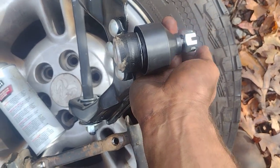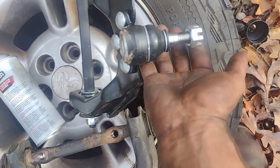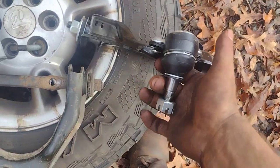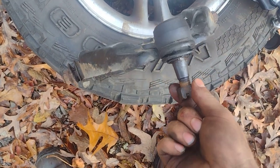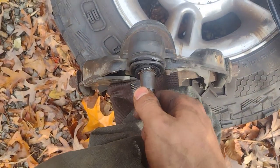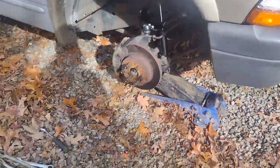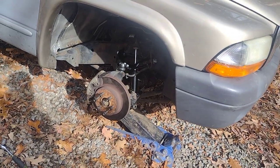Take your ball joint nut off there - that's just a little cover that protects your threads. That one's good and tight - I can move it but it's firm, that's what I like. But this one - yeah, that's a two-finger roll. Look at that - two fingers and it's been in there about 13 months. Just a little over a year and it's already got slop in it. Quality nowadays is definitely questionable.